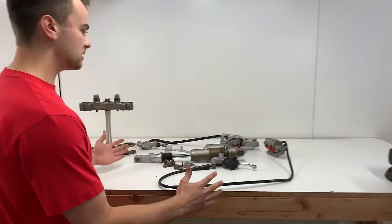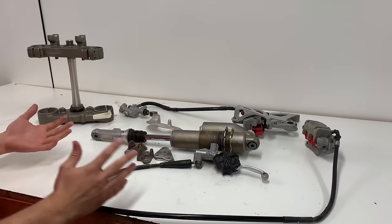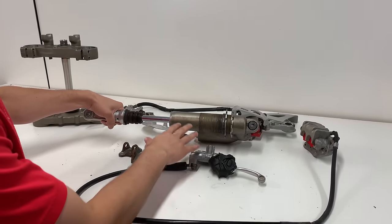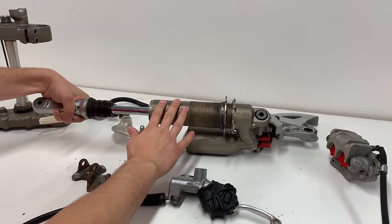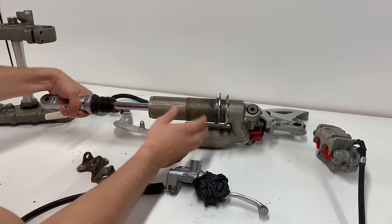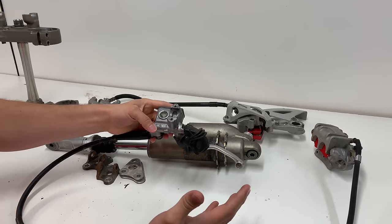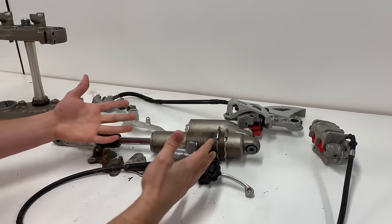But if you look here, these are the majority of the parts I'm going to be Cerakoting. I think this is everything, but I may add a couple parts down the road. The reason why I'm choosing to Cerakote some of these parts as opposed to powder coat is because of the thinness of the coating. Cerakote is just as strong as powder coat and has great corrosion resistance, but it's so much thinner. So for threads like this or for little clearances on your braking system parts, Cerakote is going to be a lot easier to keep out of the threads